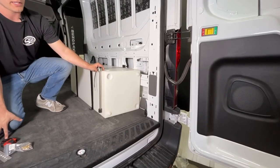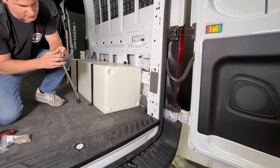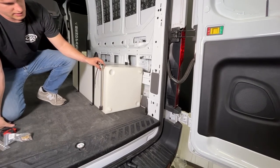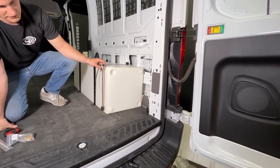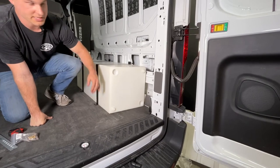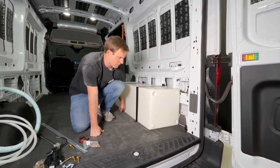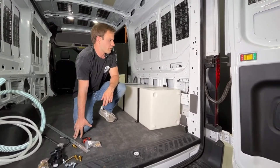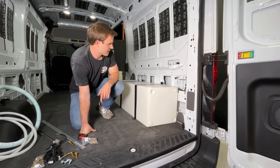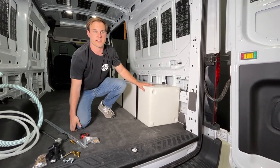Right here is a 15 inch level sensor. The part number is S5U15, made by KUS. It's 15 inches and it's perfect from the bottom. The same fittings that we have on this side are also on the front. So if you want your feed at the front rather than routing it all the way around, you can have your feed right at the front if that's where your pump is.